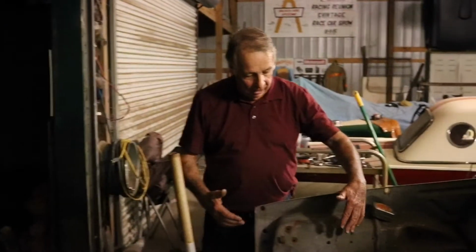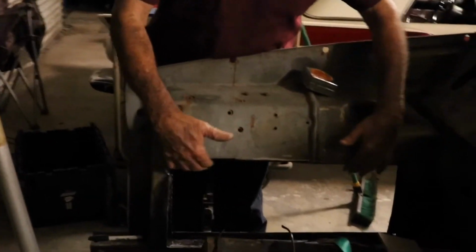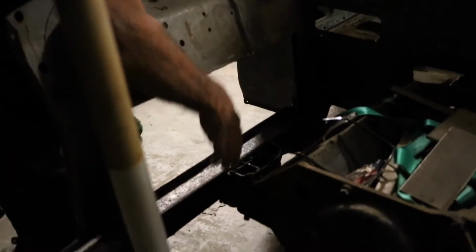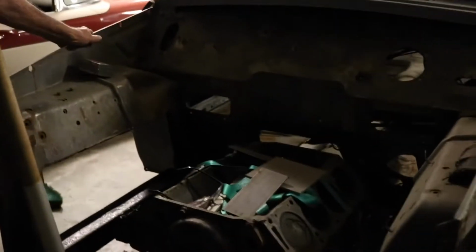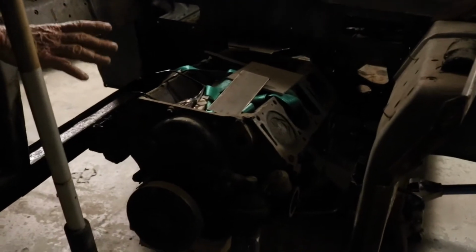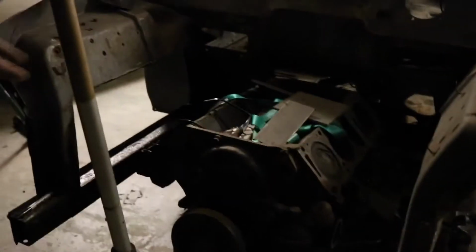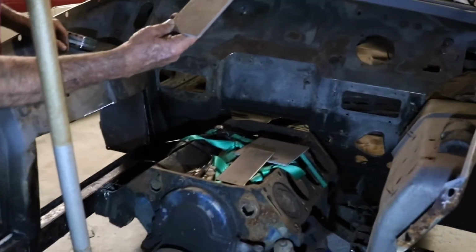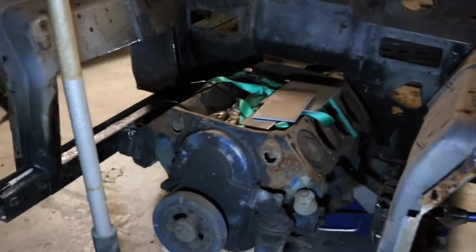All right, this is where we've got with the Willys today and yesterday. I had to come in and cut the inside fender wells out. There's a two-piece fender well here, an outside and inside, and because the heads hit the inside here, we wouldn't have been able to get the valve cover off. So I've cut them out inside and outside, and we're going to put a piece straight down, and that'll make it very accessible in here. Today we came in and positioned the motor where it's going to go, and we've got it set up at the right height and everything. We're going to do some tweaking tomorrow to make sure everything's right. I got metal for the motor mounts to build the pads, and all I've got to do is put it up there, mark a hole in it, drill it, and weld it in.